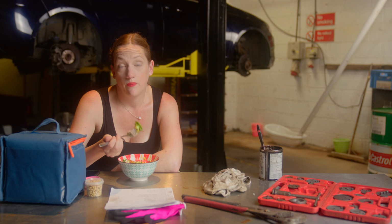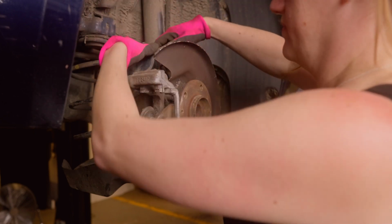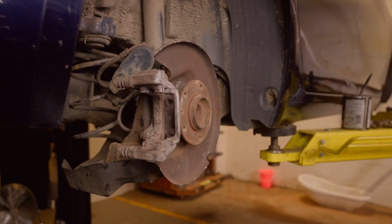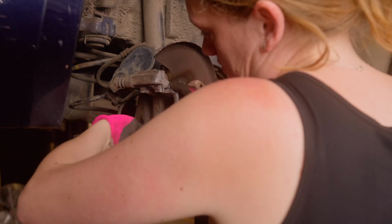With the handbrake now wound back, I've got to remove it all to fit the disc. When winding back handbrakes on cars with electric park brakes, you need to follow a set procedure. It's different on every car, but on this Peugeot, it is simply a case of winding in the caliper. Tammy figured out that refitting the caliper was the best way to hold it. Or did YouTube come to her rescue?